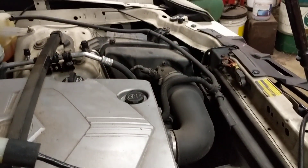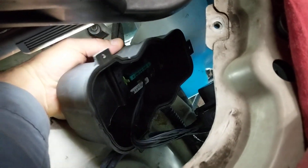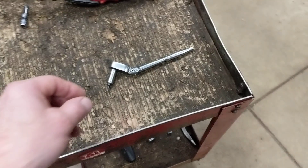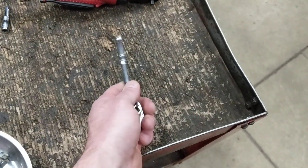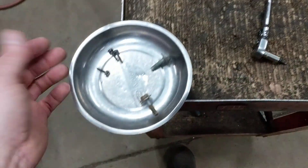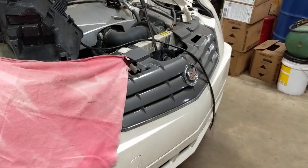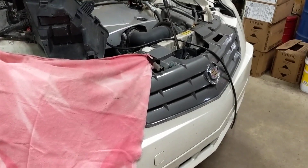This is the passenger side — I have not done the driver's side, but I assume you remove the air box and it's the same way. There's a gasket in here so be careful with it, but this was not that hard to get to. I'm in here in just a few minutes to replace the low beam bulb. I didn't use many tools: a small torx bit, flex head ratchet, I'd use an air ratchet on the top one, a mirror was helpful, and a little magnet to make sure I didn't lose anything. It can be done — I'm not going to say it's quicker, but I'm not going to say it's slower. I just know I did not disturb a whole bunch of body panels that didn't need to come off. I believe it's the same for '04 to '09, so hopefully this saves you a little bit of time.